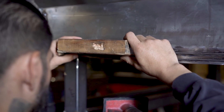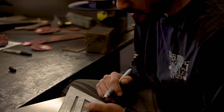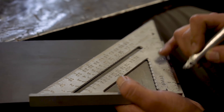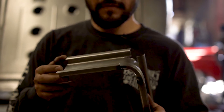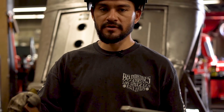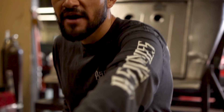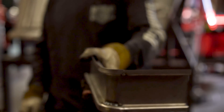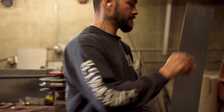So what are you working on right now? I'm gapping this — finishing the rocker top side, the visible part of the rocker. I want a perfect gap all the way around the door and it's not doing it right now. They might name a holiday after the day we put the body mount on — that's how huge it is. But I'm using this: steel weld won't stick to copper, that's all it does. Since I have a small gap here, I stick this in the back so it comes out flat. It's like modeling clay — you put it on the form and that's exactly how it comes out on the back.